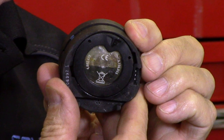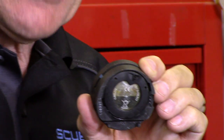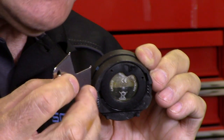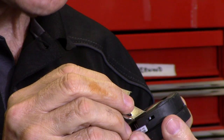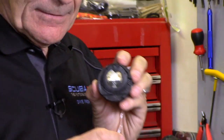Let's do it quickly. You'll notice there are two little holes on that black ring. Out the bottom of that black ring it shows 'open' and 'closed.' If you're one of those people that saves everything, like me, you'll still have the tool that came with the computer — yes, it came with it. Take that tool, put it into the two holes, give it a turn, and that loosens the ring. Now the ring is free and you can get something underneath it and pull that black ring off.